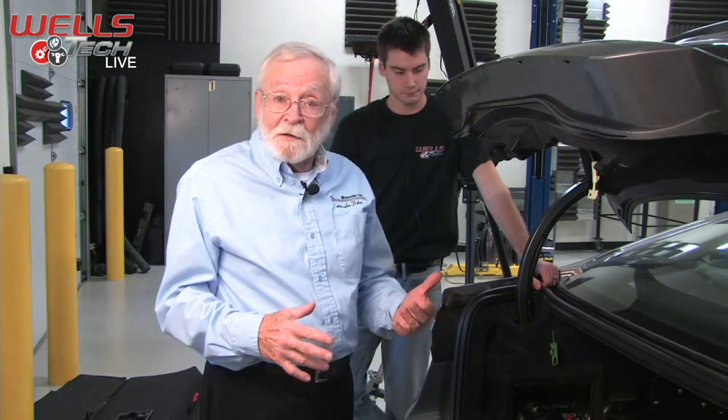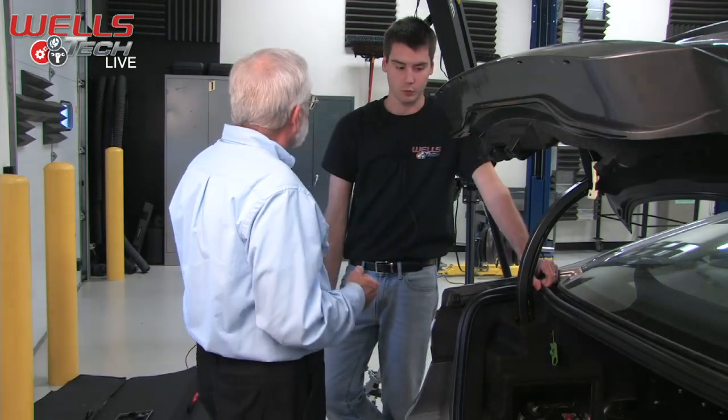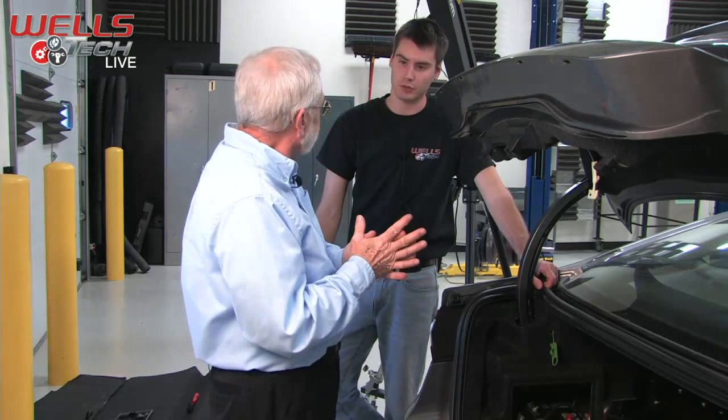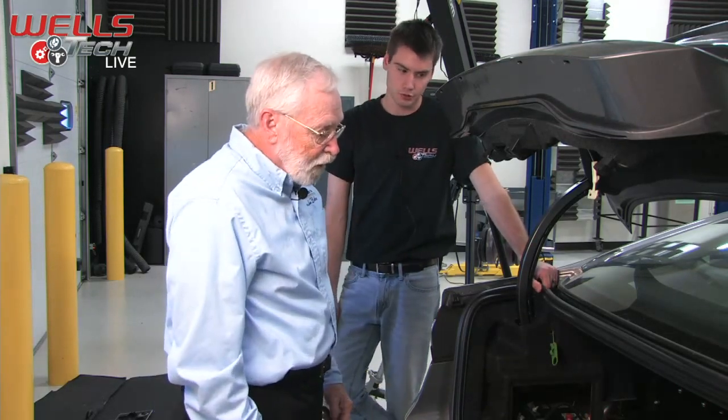Again, this is where you're going to have to go to your service manual for the vehicle that you're working on and find out where it is, and also where the input and the output terminals are. So in normal car terms, we kind of just want to check the output of the charging system, like checking the output of the alternator. Now we're going to check the output of the DC to DC. In this particular case, though, we have two things to check.